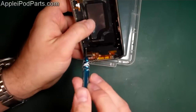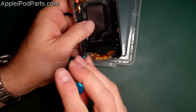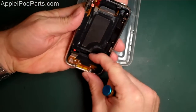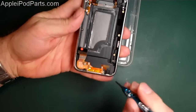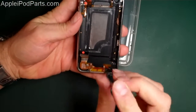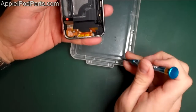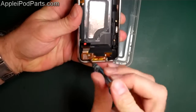All that's left to do now is there's a little screw underneath that connector, and that little screw comes out eventually. There we go. We'll pop that in that little corner tray there. And this lifts up — oh no, my apologies, two more screws down there. Even the pros have a slight lapse. Two tiny screws that actually hold the dock connector in there. They're really diddy. Doing our best to try and keep them in separate pots for the rebuild.